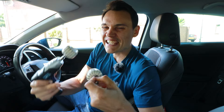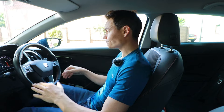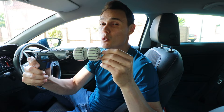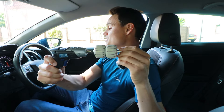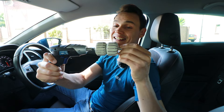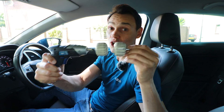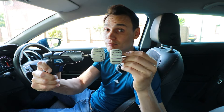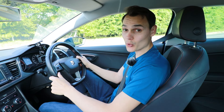When pushing the clutch down slowly, they're slipping, they reconnect, and then finally they're disconnected. It's that reconnection that causes the jolt. The problem is compounded by the fact that your clutch pedal has a long travel from top to bottom, but under your bonnet the clutch only actually moves by a few millimetres. So it's important to get the clutch down quickly to separate it from the engine without any intermediate slippage stage.